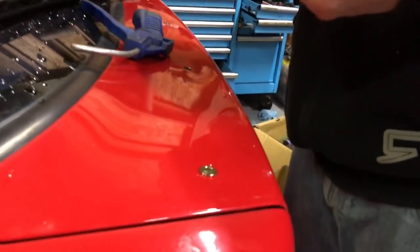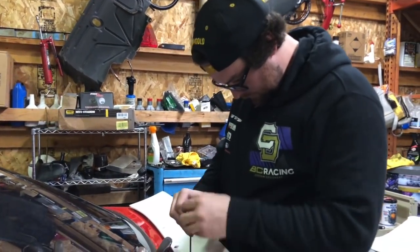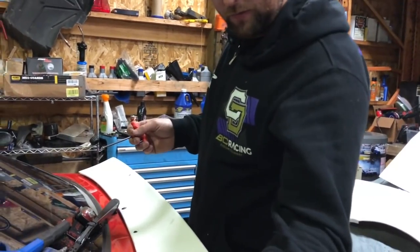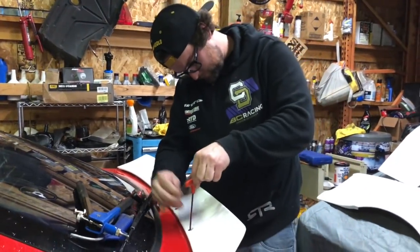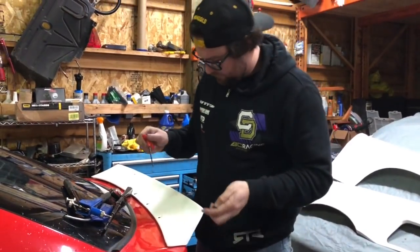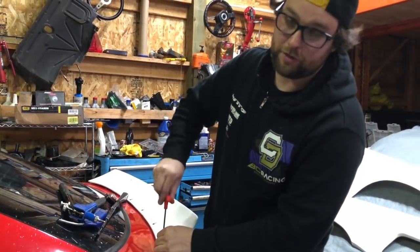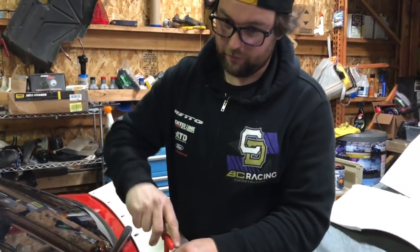Now you have a screw in the body where you've been working or need to work. So now that we've got our riv nuts in there, we can just thread them in there and get them started. And then again, these are quarter 20s. I feel like that's the best size for this stuff. It's definitely overkill, but you want a big enough button head on here so that you don't have to run like a washer or anything. Obviously we're tightening these on the fiberglass too, so we don't want to like over crank them or anything.